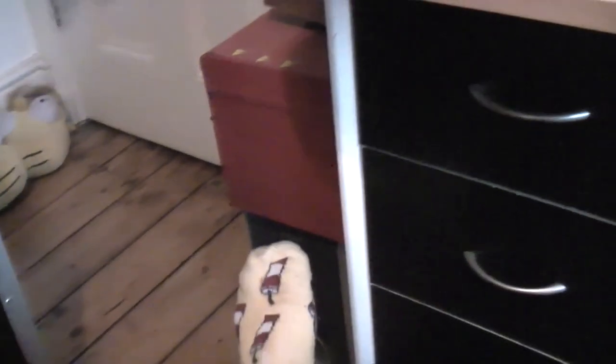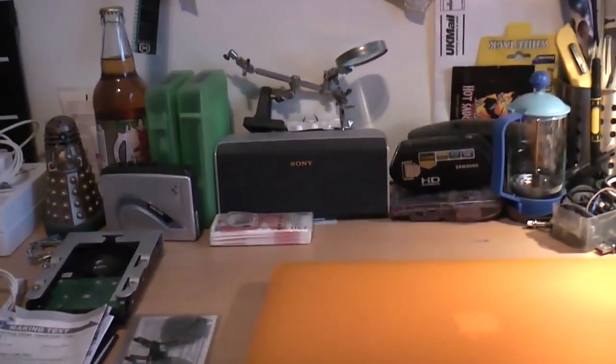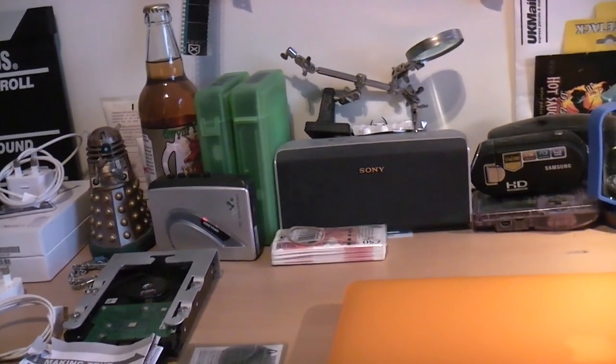Coming down here is my sub. Even though it's the Sony sub, I don't actually want to upgrade it — it's a really nice sounding subwoofer, rock solid. It's not quite got as much grunt as my Creative sub under the desk for the computer, but it's definitely decent. The only annoying thing is it's a passive subwoofer. Because I want to upgrade my receiver, you pretty much need an active sub with a normal AV receiver since they don't have an amplified subwoofer output. So either I run it with a separate amp or I get a totally new sub.